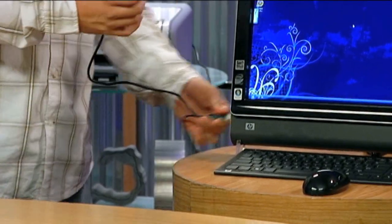Before you get started, make sure that everything is unplugged — all the peripherals. You want to make sure the scanner is not plugged in, or the external hard drives, or a printer. Also, a full system recovery will delete all the files, all the programs, and documents that you added to your computer after you bought it. So make sure that you back everything up before you do this. A detailed written description of what we're performing is in our limited warranty guide for the HP TouchSmart, and your troubleshooting and maintenance guide for HP Desktop.